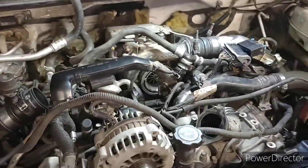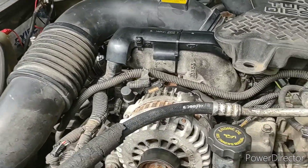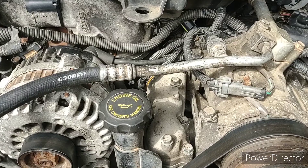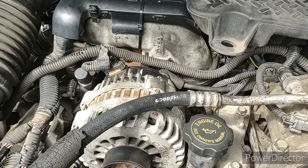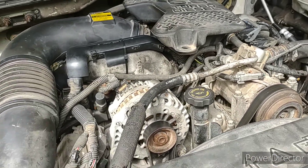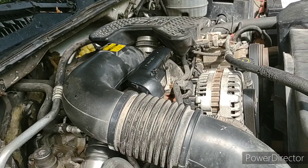In conclusion, if I was to do this job again I would probably remove the thermostat housing that goes all the way around — it probably would have saved me some time getting in there and getting it swapped out quicker. The fuel pressure regulator sensor is swapped out, the truck is running good again. I put my scan gauge on it and the actual versus desired is matching, it doesn't shake, and it runs pretty good again. Alright everyone, later.